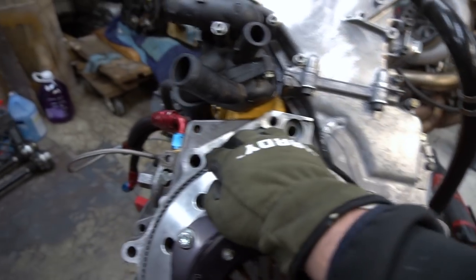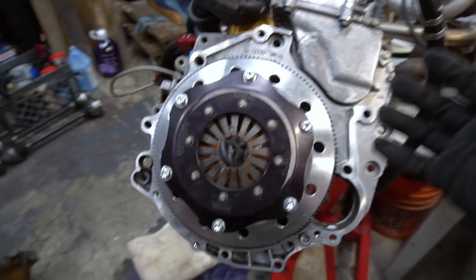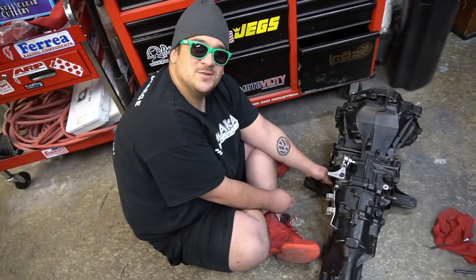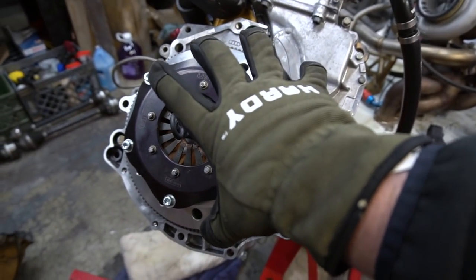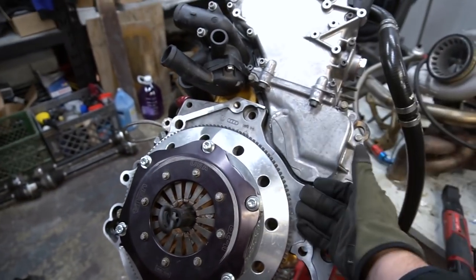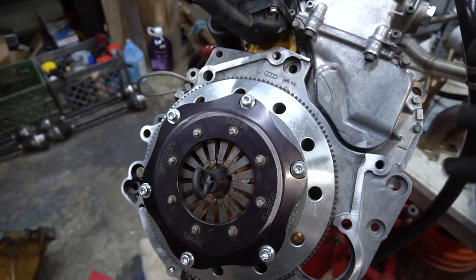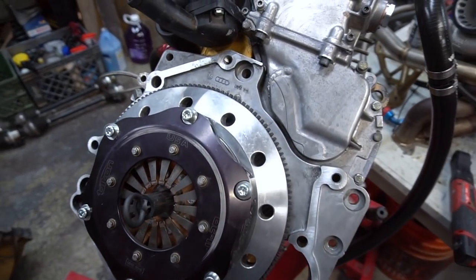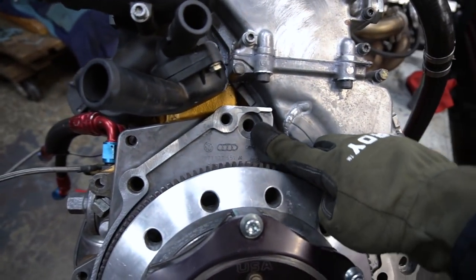The issue with using an adapter plate — even with dowel pins — is it's hard to keep it from flexing when you're making power with these motors. Flex is a huge issue. That one bolt going all the way through and tying the motor, the adapter plate, and the trans together is really going to help keep it from twisting apart. That's going to help you keep clutches happy, keep motor mounts happy. The VR6 is already a heavy motor, the 01E trans is very big, and applying 35 to 40 pounds of boost making seven to eight hundred wheel horsepower in these cars — just give yourself every chance to eliminate any flex whatsoever.